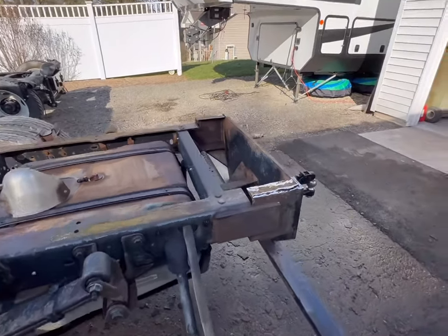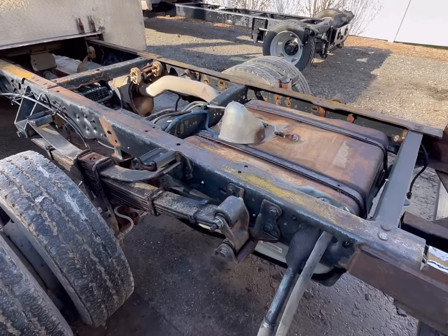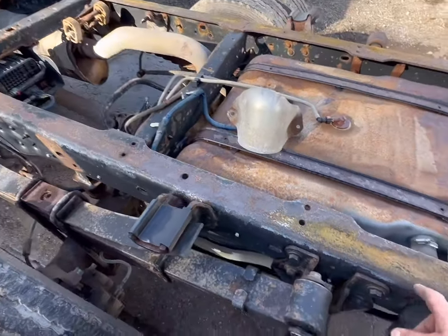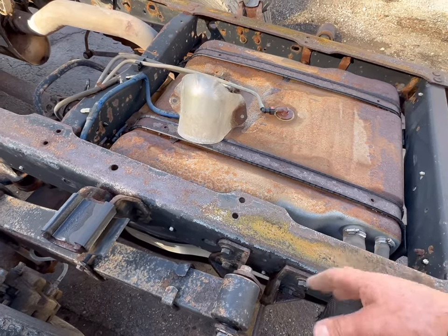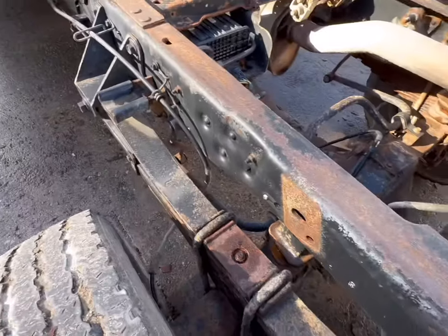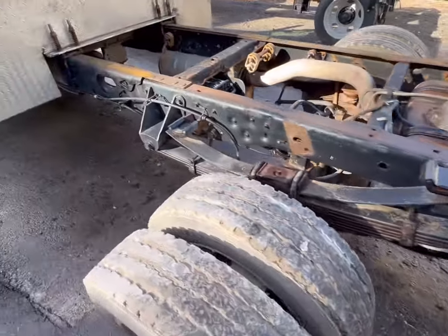So what I'm going to do is, it's supposed to rain maybe late tonight and tomorrow. I digress, backtrack. I power washed it once I was done with a narrow, I think like a 20 degree or a 15 degree nozzle. And what we didn't get with the needle scaler, we got with that. Cleaned up the top of the fuel tank inside all of these, you know, these spring stops and hangers are notorious for keeping stuff. So it's been power washed now.